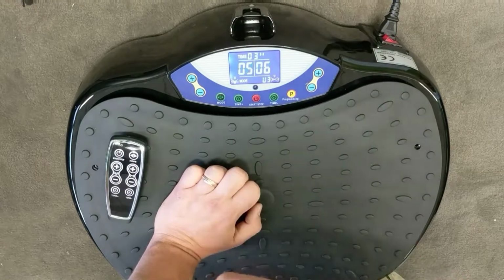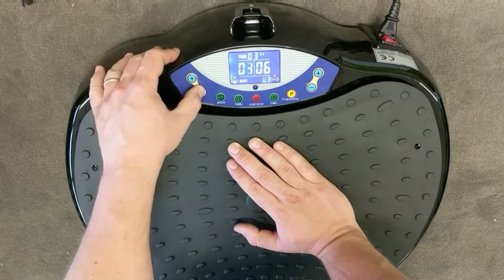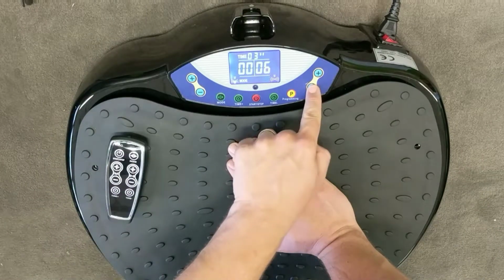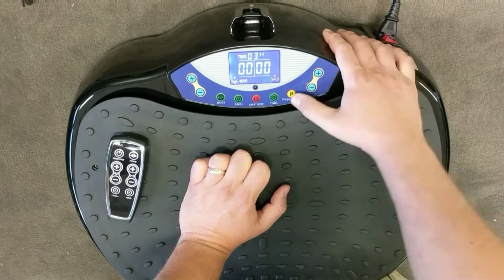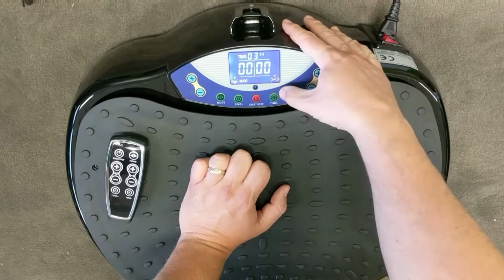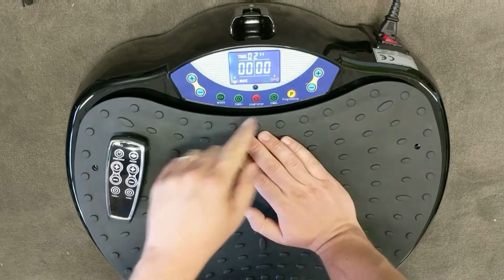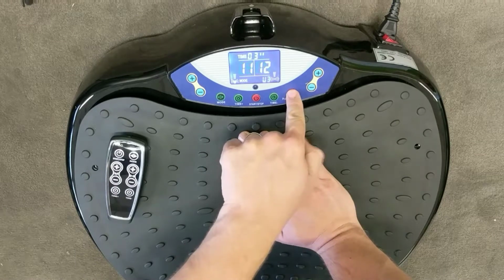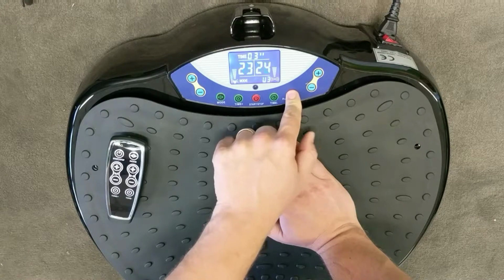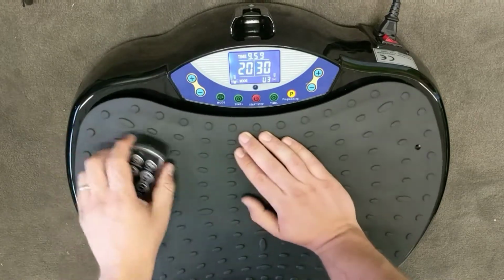Press program again. Third step, maybe I want it to shut off for a couple seconds. So what you could do is go to 0, push a little harder here, 0. And I want it to just go to 0 for, we'll say, 2 seconds for a little break. Totally up to you. And you keep on doing that for every single cycle, all the way up to the 12th one. And then you can hit start.